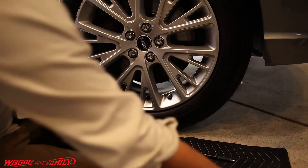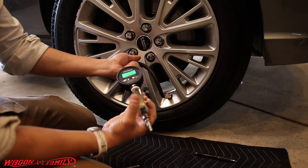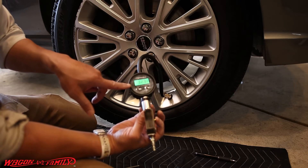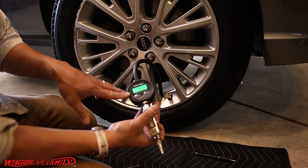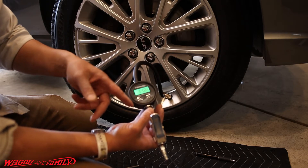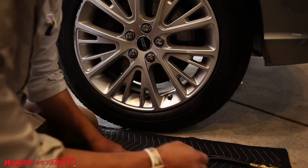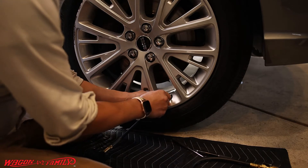Method two is your air chuck. You can either push the little valve on the side to release pressure — it's reading 32.9 PSI — or to go a little faster you can just pull down the handle. This is okay too, but it's still a little slow because of the restrictors inside. The more restrictions in the way, the slower the air comes out.